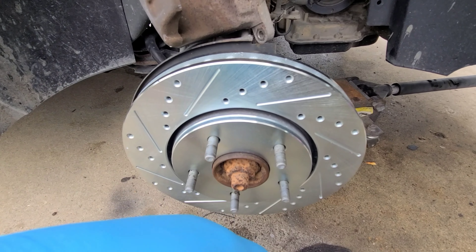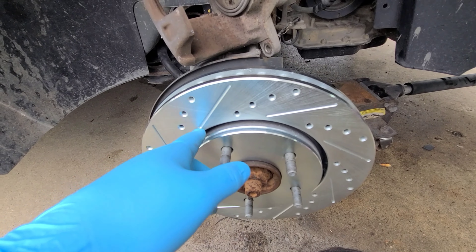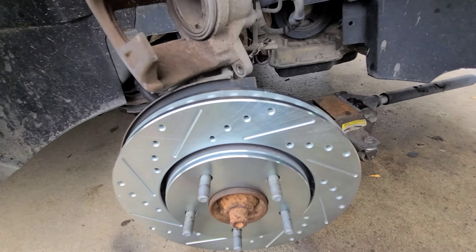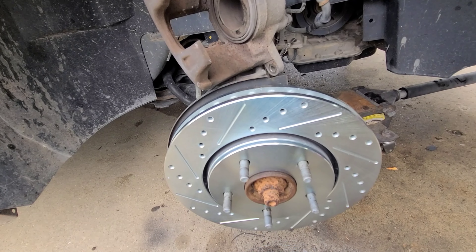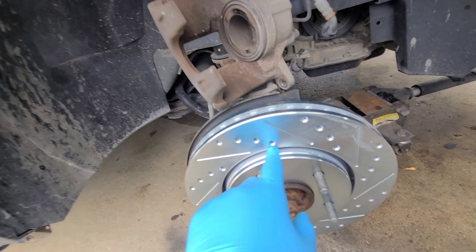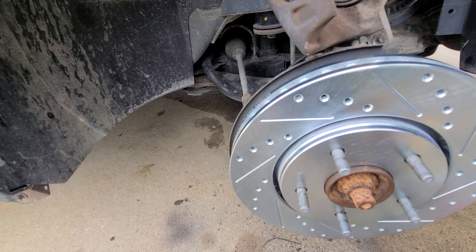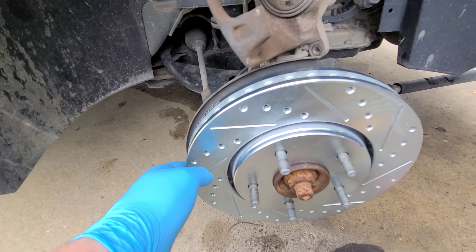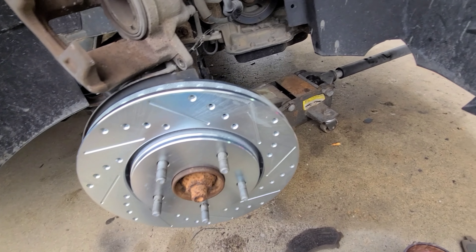Welcome back. Here we have the rotor off. For those of you that are educated, you'll notice this rotor is for the driver's side, not the passenger side like it's on right now. These ribs, the slots, should point to the back of the car — but they're pointing to the front. So I'm putting the right one on; the slots are now pointed towards the back of the vehicle, the way it's supposed to be. Typically they are labeled, but these ones are not — not a big deal.